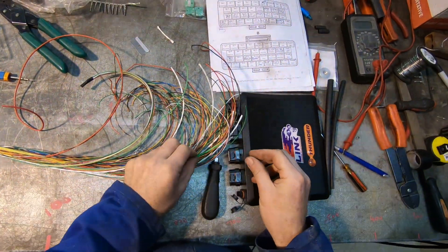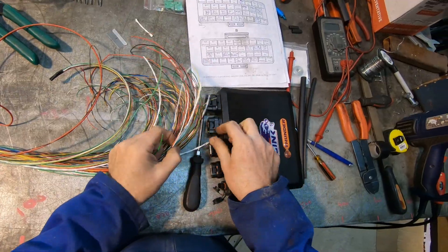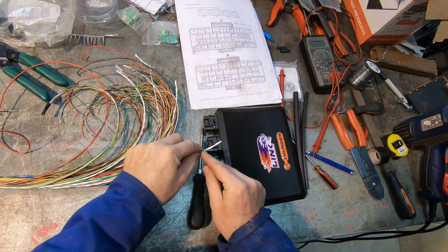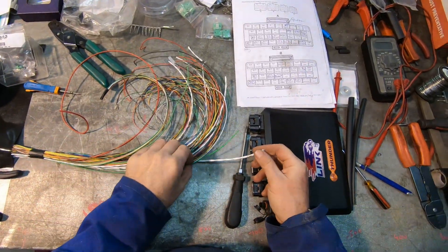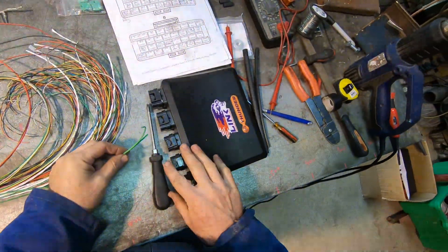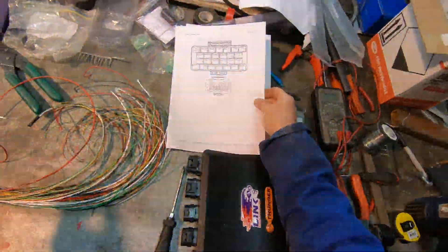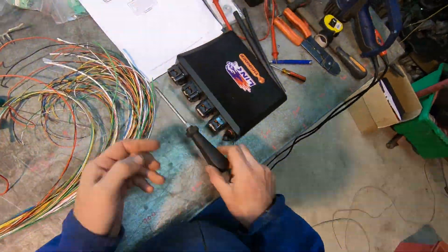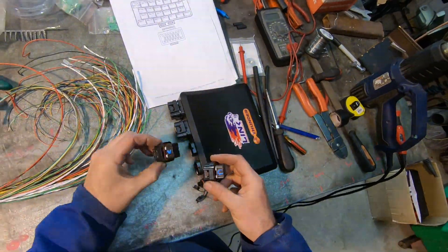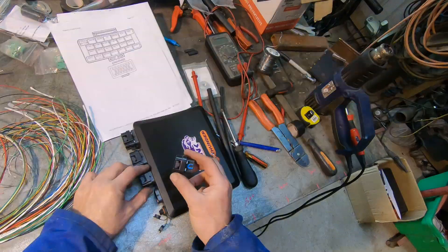I'm going to the shortest wire. I was aiming for the crank sensor wiring to be my shortest, but I'm about 25mm shorter with the EGT wiring. So I'm going to start with the EGT. It comes out to the D plug, and I'm right at the top edge of this D plug. My D is the crappiest D you can imagine.